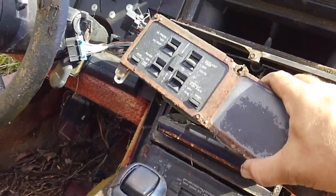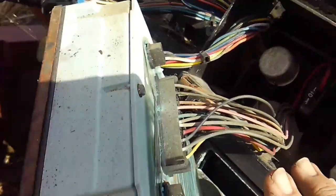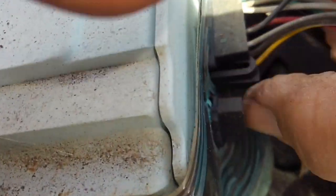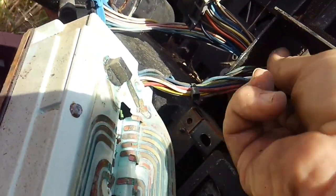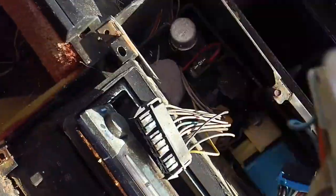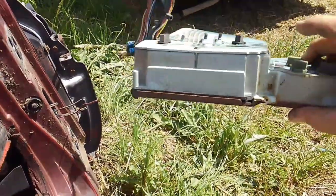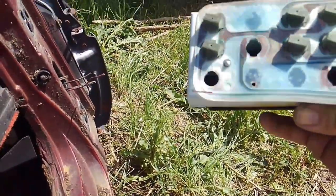As it comes out, you'll see on the back side there's a retainer where your plug goes in. That pulled out for me, and then you've got one harness that feeds directly over into the instrument panel. That's it — that takes the whole thing out of there, and that's what the assembly looks like when it's removed from the car. Nothing too difficult.